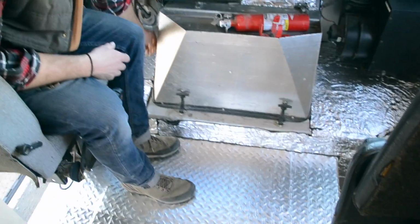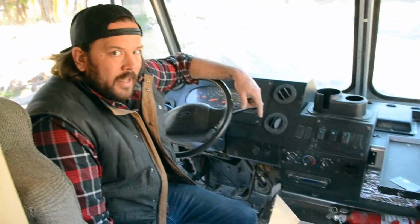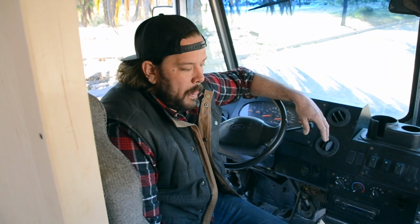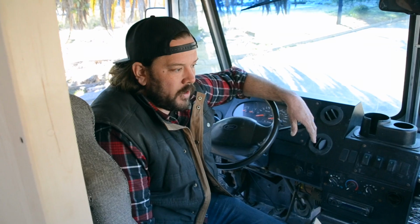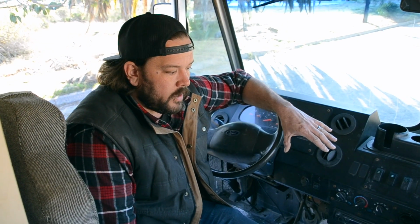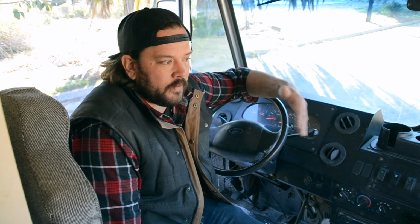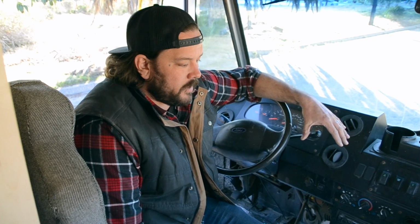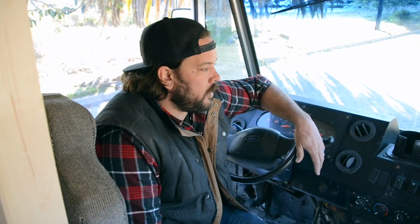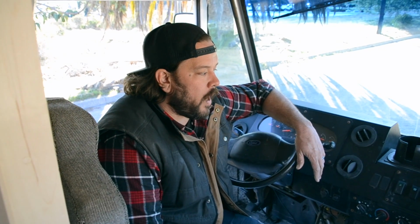Covered that over every surface and some of this padded fat mat. And we put it inside the engine cabin against the firewall in the rear, and it's heat resistant. It's made to do what it's doing right now. And applying this brought the noise range down incredibly. Before this was in, you had a constant engine drone, and it was difficult to maintain a conversation. With this in, and the carpet that'll eventually be there, it almost makes it like any standard Chevy van or Econoline van. So yeah, it's pretty quiet.